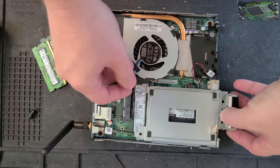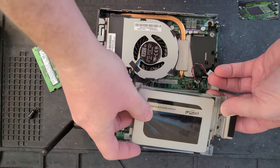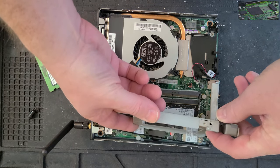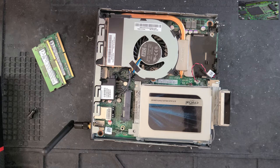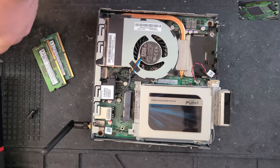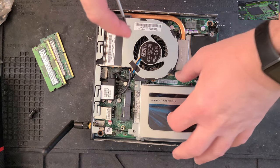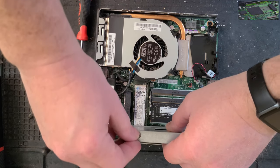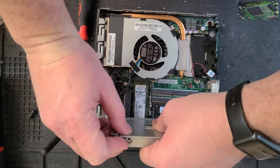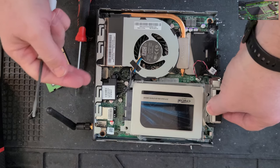I'm leaving the 256 GB M.2 SSD that came with this system in place. We're going to install Proxmox onto that SSD, and Proxmox will automatically partition the drive into a VM storage partition and ISO storage partition. If we use a larger SSD, we wouldn't be able to use that extra space as a network share — it would just make those other two partitions larger. If we want additional hard drive space for things like network storage, it needs to be on a drive separate from what we install Proxmox onto. So I'm also going to add in a 1 TB 2.5-inch drive for media files. Mounting it was a little confusing — I had to put in the screws loosely and then push the hard drive back after setting the caddy in place, so it would socket into the SATA port.